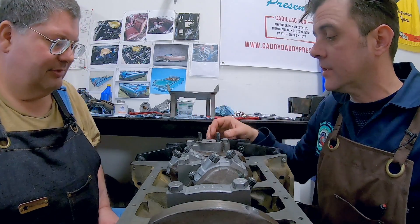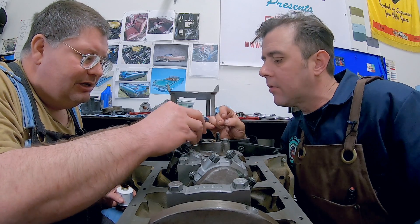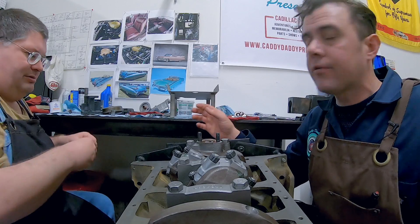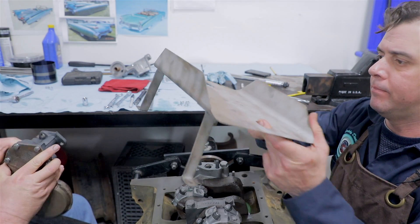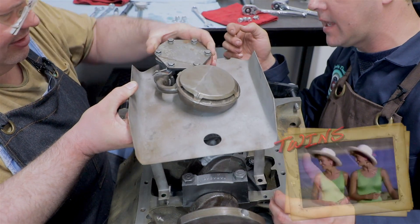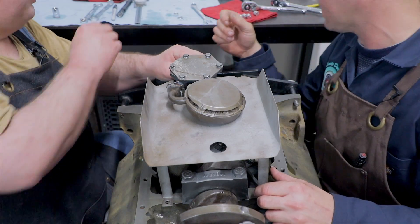It's down here on the bottom of the engine. What we're going to do is install the oil pump and the windage tray. First, put a little bit of gasket sealer right on that surface — I usually don't put it on the gasket, just a little bit on that surface. Just a little safety margin. Get the same surface on the oil pump. These motors had a factory windage tray, and not all engines have these, but the Cadillacs this year did. It's a sheet metal plate that sits below the crankshaft. We kind of have to fit the oil pump and windage tray together — they have to go in as twins. When you get the oil pump lined up, then you can adjust the tray later, because you will need to lift it up to get clearance to put the nuts on the oil pump.